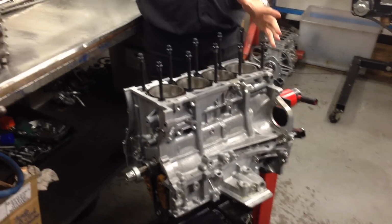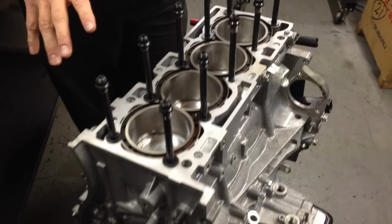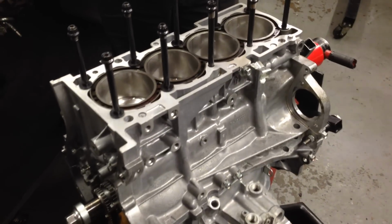And what I've got here is the basis of an original engine out of the EVO 10. This particular client, and you can see with the head here, and I'll go into detail with all these in a minute, but in summary, it's a 2.2 stroker upgrade with an engine that had a failed piston due to less than desirable modifications on the car.